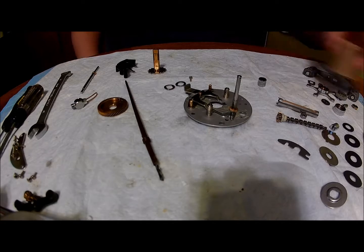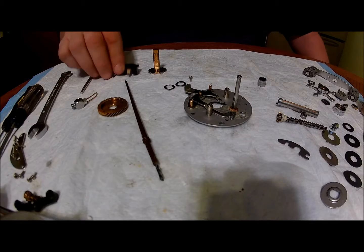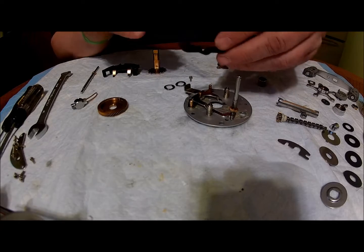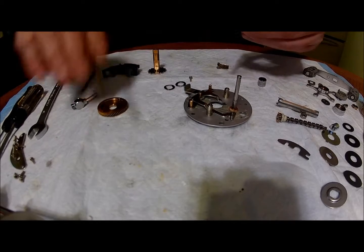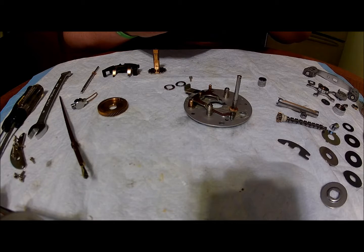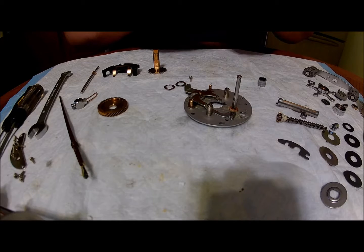And then we're going to grab this pressure plate, but you don't grab that until you grab your yoke, which I like to put a little bit of grease on right there in this area right here. It's going to rub. And you're going to put your pinion in there, which usually I end up putting that in upside down 3 or 4 different times before I realize what I've done and why things ain't going back together right.